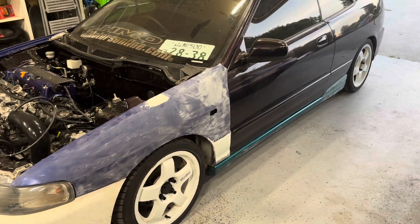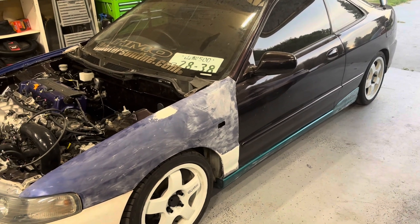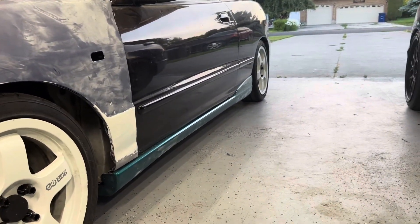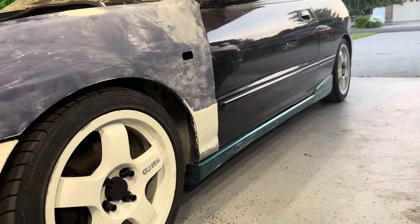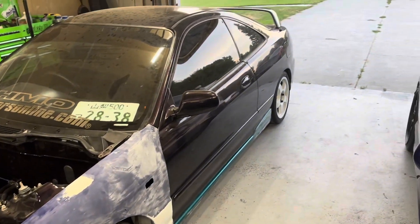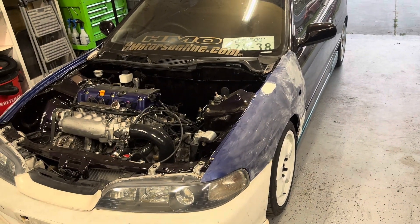That's what's in store for the car right now and what's going to be in the works the next couple of weeks. I'll try to upload once every week or once every two weeks depending on how I'm feeling and what kind of content I can put out. I will do a video of the 5-lug swap and try to do a really good in-depth step-by-step on how to do it. It's pretty self-explanatory, but I'll still go over how everything works from start to finish — swapping out the front knuckles, swapping out the rear trailing arms, and even doing a four-way alignment covering rear toe, rear camber, front toe, and front camber.